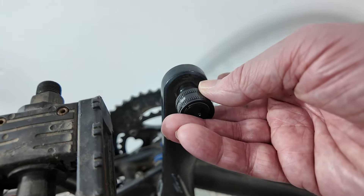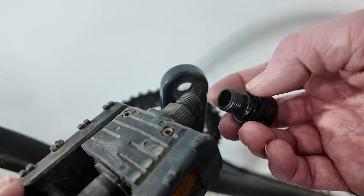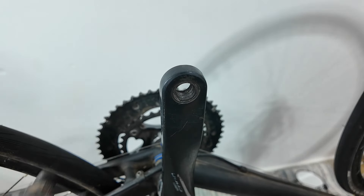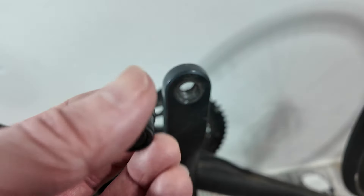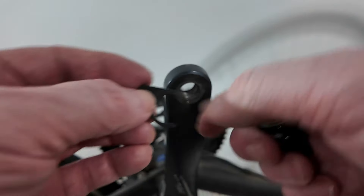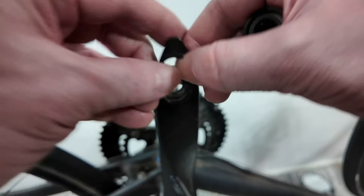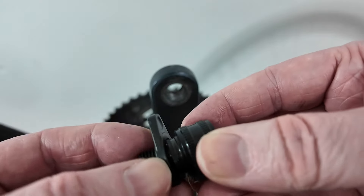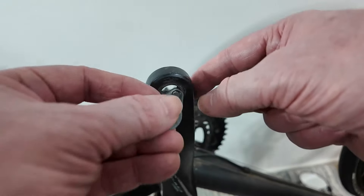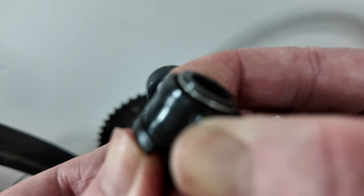Or even just for packing, because sometimes it's in a car or something — instead of having a folding pedal, you could just take that away completely. So remember folks, you get a left and right and your threads go the opposite way — the left one you go anti-clockwise, the right one normal. You get a plastic spacer piece in case you've got a recess in the crank. But some people just use washers — even on the MKS site they show it with washers — just as long as you get rid of any crevice so you can do the quick release thing.